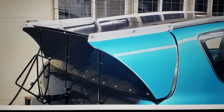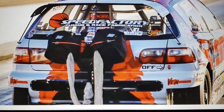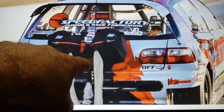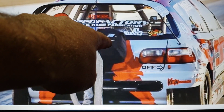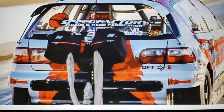The last picture is a well-known civic — friends of ours — everybody recognizes the back of the old outlaw car. They didn't have the wing plates all the way down; they did some aerodynamics underneath that we won't touch on in this video. But right at the edge you can see they have the wicker bill. Their tether point is mounted high like mine, because they ran 200 miles an hour in the quarter — they have to run two chutes. They run two small Stroud 400s or equivalent, canister-launched. The angle is high, so when deployed the chutes will actually be above the roof line as they're inflating.